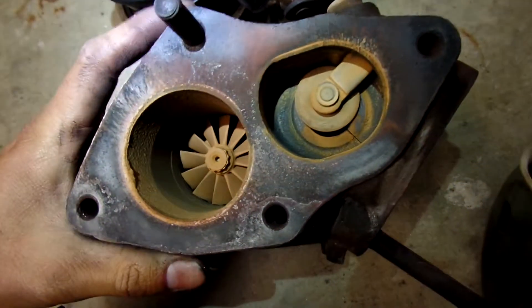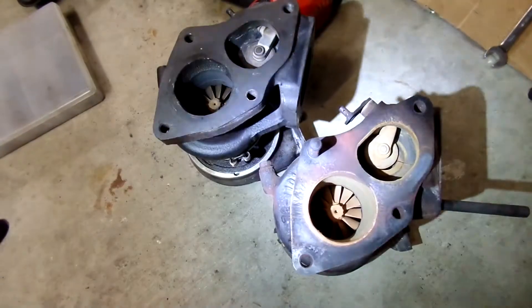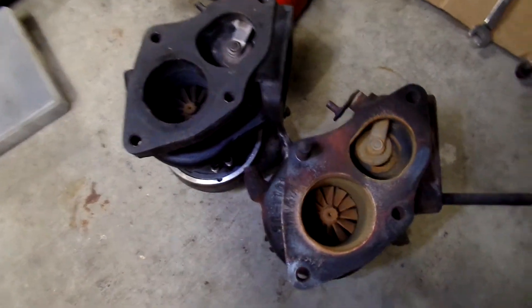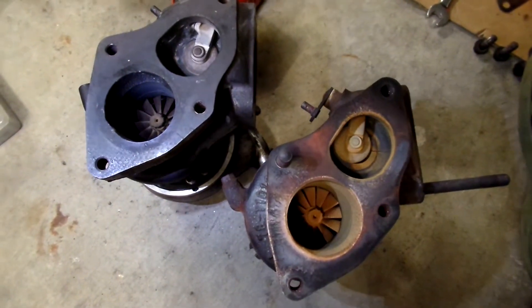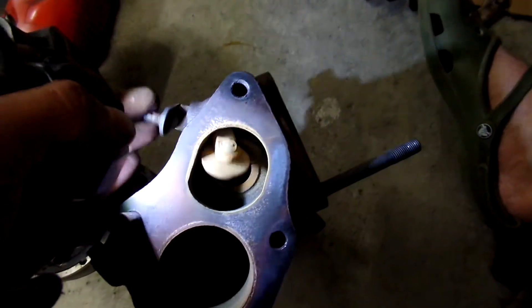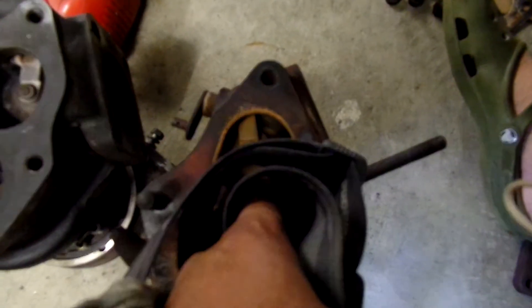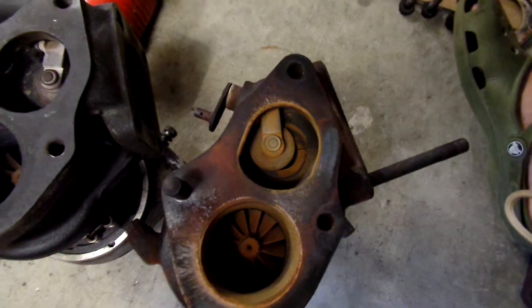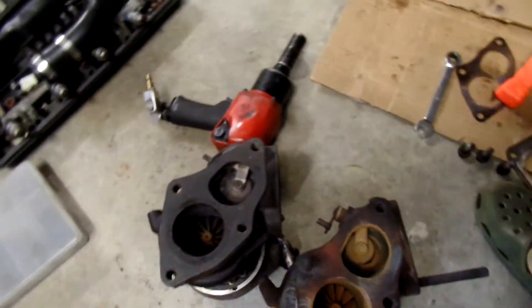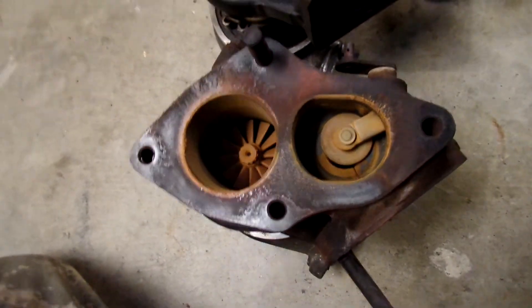The exhaust wheels look to work the same. The wastegate on this one is leaking — look at it, the arm is not in the right place. It's leaking — there's a little leaky situation here — so that's no good. It's supposed to cover part of the hole like this one does. So this one is always leaking; he's probably never going to achieve the full amount of boost on this turbo. That can't be good.